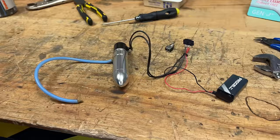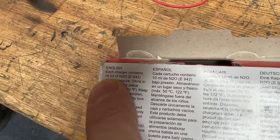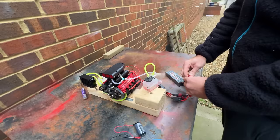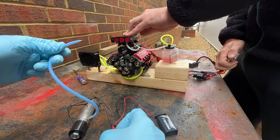So here we've got our nitrous oxide system. If we hit this button here, it just runs on these little cartridges. N2O - nitrous oxide, baby. So when you're running nitrous, you've actually got to have the engine running a little bit richer. So I think we'll get it running again, see how rich it will run, then feed it nitrous and hope for the best. We've got two carburetor holes, and to get the nitrous into both, we're going to put this little fake supercharger hat back on. I think we need one person to run it and one person to do the NOS - two-man operation. We're going to aim it here. It's probably going to go lean and conk out, and then we'll switch it off. I'm going to show a little logo up here every time the nitrous is on.